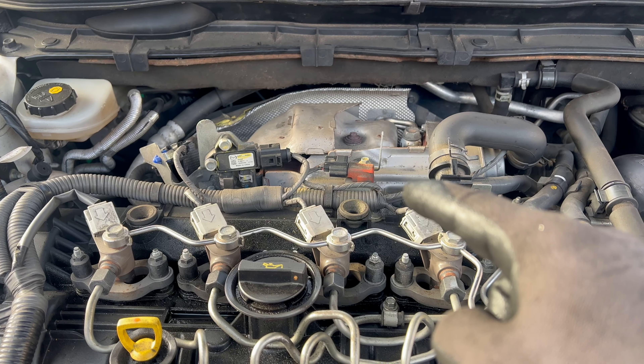I'm going to remove the old one and swap in the new one. I have unplugged two injectors, disconnected the exhaust pressure sensor, and removed those plastic plugs which hold the wiring to the valve cover, just to have better access to the exhaust pressure sensor and the bracket. There are two bolts — eight millimeter bolts — one for the sensor and one for the bracket. I remove the sensor bolt first and then the bracket bolt.